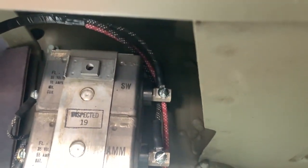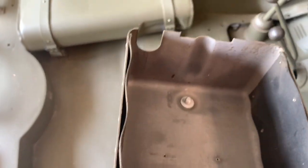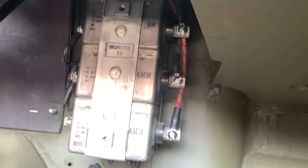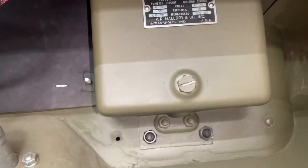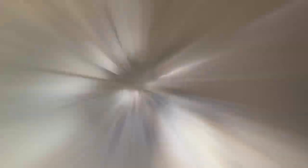You see the red with the three on the bottom, the black with the three in the middle, and the two tracers on the black at the top — and they're exactly across. Notice why I had those wires turned upwards and back. Inside the cover, there's some black cardboard and two screws on the top that you've got to line up with the two slots on the filterette. If you have trouble when you slip this cover over, don't force it and pinch the wires. Make sure you've got them all nice and tucked; even if you have to loosen your screws and re-tighten them again, you're going to want that cover to come out the top.